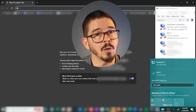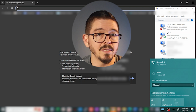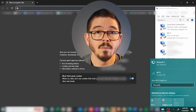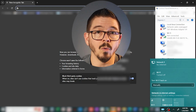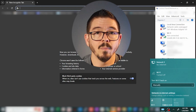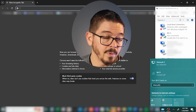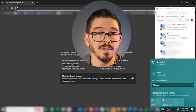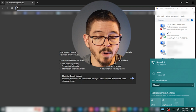If you need to, because you don't have an Ethernet connection or an adapter to connect to it, which can be done on laptop, PC, Mac, Linux, even a tablet, or in some cases a phone via USB to Ethernet adapter, you can do this through your router interface, but some routers need special routing rules to be able to access the different subnet that the InvisaGig has at the address of 192.168.225.1. All you need is that IP address. You don't need anything special to get to it, just a web browser.